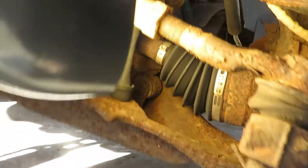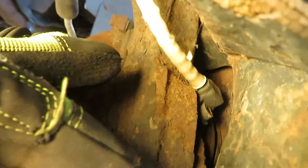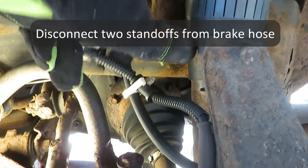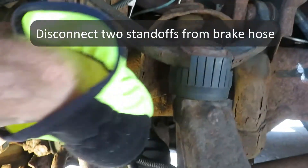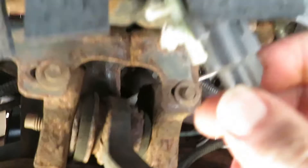There's the sensor. To get it out we're going to have to remove the brake caliper bracket, the rotor, and the dust cover. A couple of standoffs need to be snapped off the brake hose. We also have to remove this plug from the wheel well cover — it plugs into two holes and one's already disengaged.